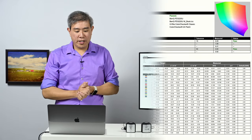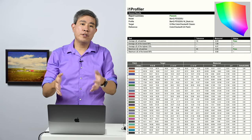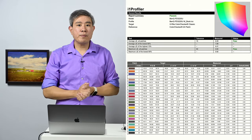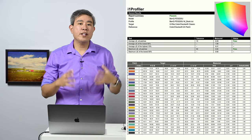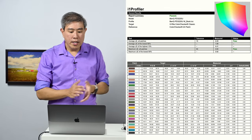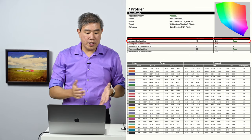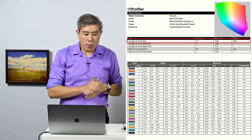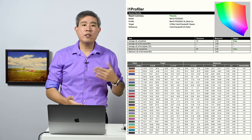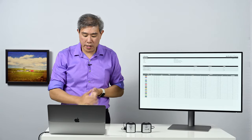Let's take a look at Mbook color mode. BenQ calibrated this display so it looks very similar to an uncalibrated Apple built-in display, since all Apple displays ship calibrated to DCI-P3. BenQ tweaked the colors to match Apple's DCI-P3 factory calibration. When running a custom calibration on Mbook mode, the average DeltaE across all patches is 2.29 with a maximum of 4.84. All DeltaE values are still within BenQ's stated tolerance, so we're still good on this mode.